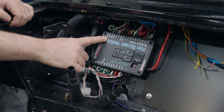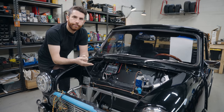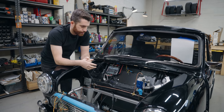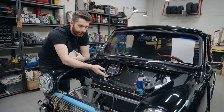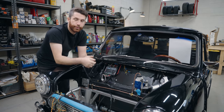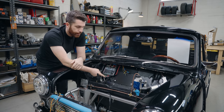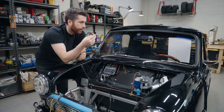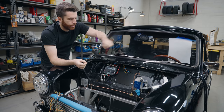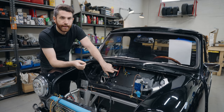We've got generic battery positive outputs, ignition positive outputs, and then all the specific outputs like high beams, low beams, horn, flashers, wiper motor, sprayer, and all of that. The way this system works is — let's take left front low beam for example — we've got a wire that goes out to the headlight, the headlight is grounded, but the activation of that power is by these 12-volt activated input sides. When you put your headlights on, a small 12-volt signal runs through the switch up to here and activates the relays inside to give power from the main battery source to the headlights.